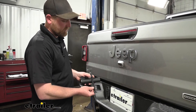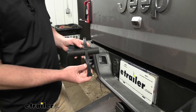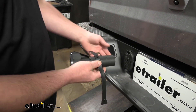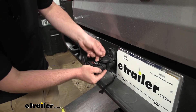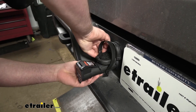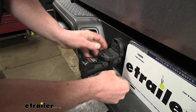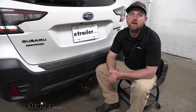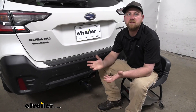For those of you that are just kind of wondering, if you need to know this, the strap from end to end is about 10 and 3/8 of an inch, and on the end of it there we're going to have a few different adjustment holes, and those are there just to accommodate different types of seven-way caps. Every seven-way is a little bit different, there's a bunch of different styles, and so by having a little bit of adjustability, you're going to have the confidence knowing that the strap is going to do its job. So at the end of the day, a great way to replace a strap that you've already had, or maybe even pick up a spare pair to throw in your glove box, just to have an extra.